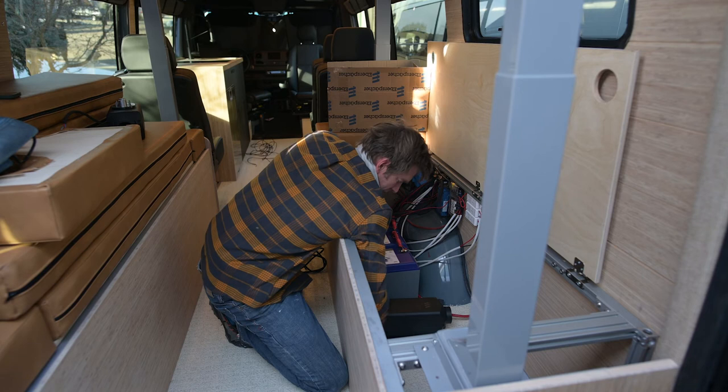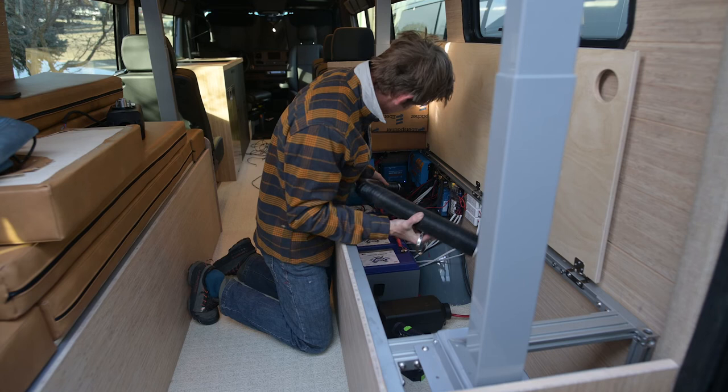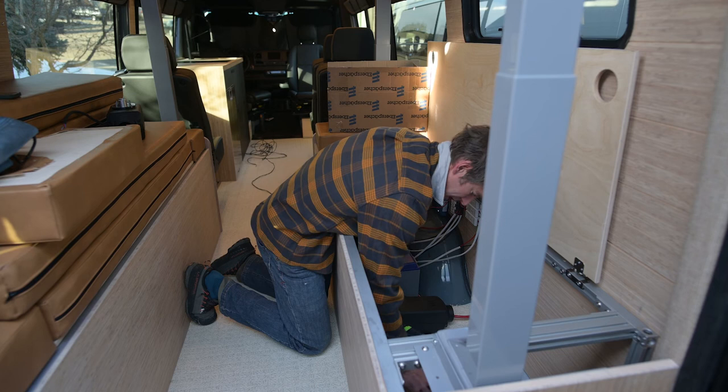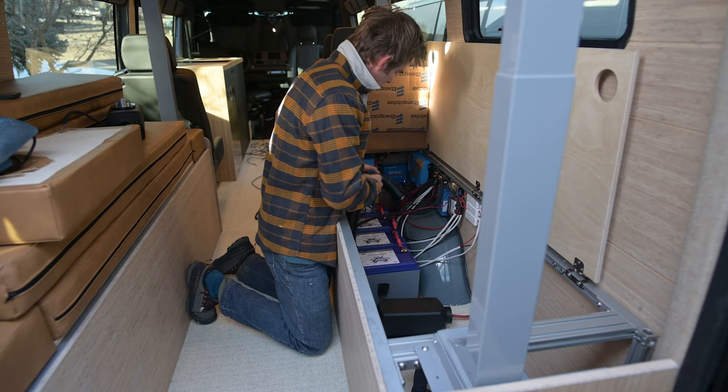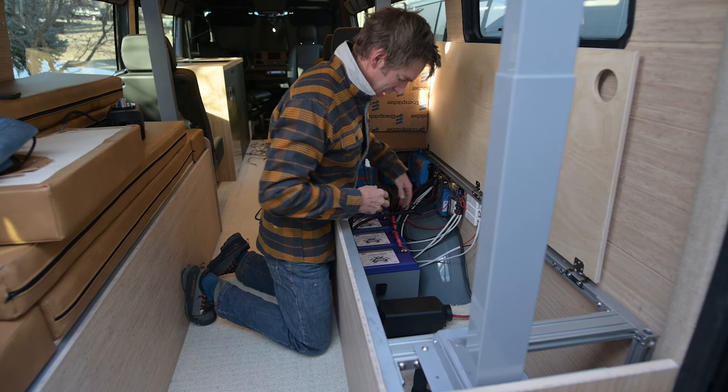And this, where this grill is, is my air in. Now this is my main air out duct hose. So I'm gonna put this right through there. I'm gonna put this on here, connect it in, and then take my 6mm and just tighten this. I'm gonna ride this through there, cut a hole in the side, and then my wiring harness, I'm gonna tuck back in there, but for now, connect these two.